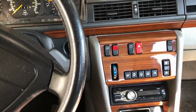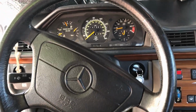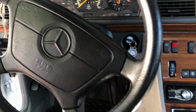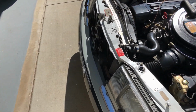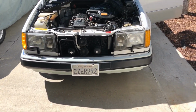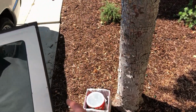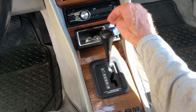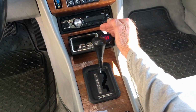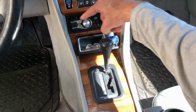I'll try driving it around, but hey, you know, I mean, come on. And then at will, AC's got temperature going up to like right here, not working. You can fire those high speed fans. They are loud. You should be able to hear how loud they are. The low speed is different. It's lower. And it's really not sucking up too much juice. Now remember, this little plug-in, it's a good reference, but the actual voltage you test on the battery is going to be a little bit higher. It might be 13.5. This is just lower because of the drop of voltage through the wiring here.